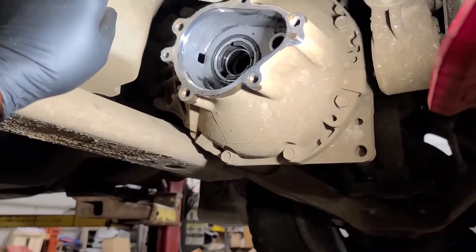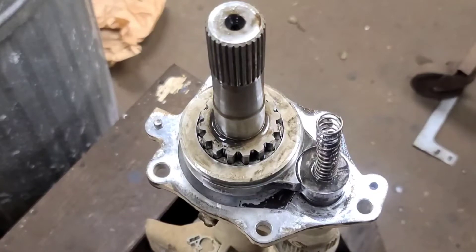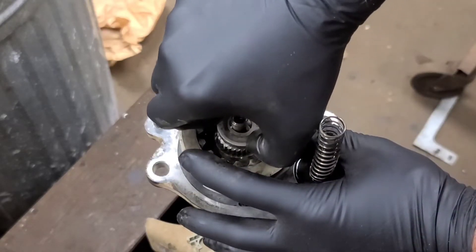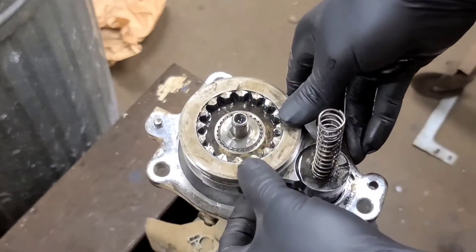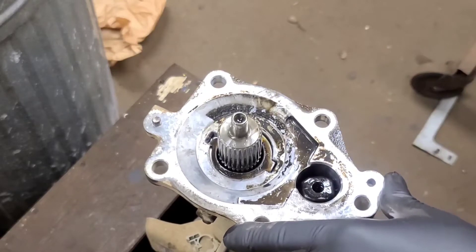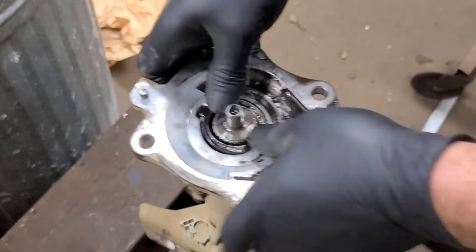The end of the axle will drop down into the housing enough that you can just barely get it out of there. I'm going to show you what I found wrong - there was some metal inside here, you can see the silvery content. Here's a look at the parts from the inside of the axle. I'm going to pull this inner axle shaft out - there's a thrust washer here that's quite thick, and the way this collar works: that's in two-wheel drive and that's in four-wheel drive. Down below here is a steel washer and there was a round snap ring in here, like they used to use on the other ones, and that snap ring was actually about halfway up on the shaft - it had popped off because the axle had pulled out.